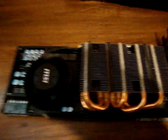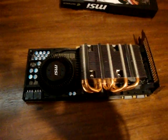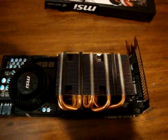Running it without the cover doesn't give it the right airflow, so it won't push air out through the back and past the heat sink, so that's not a go. Hopefully if I get a job, I'll be getting an aftermarket GPU cooler. I haven't seen any out yet, but they should be unveiling some soon for the GTX 470.